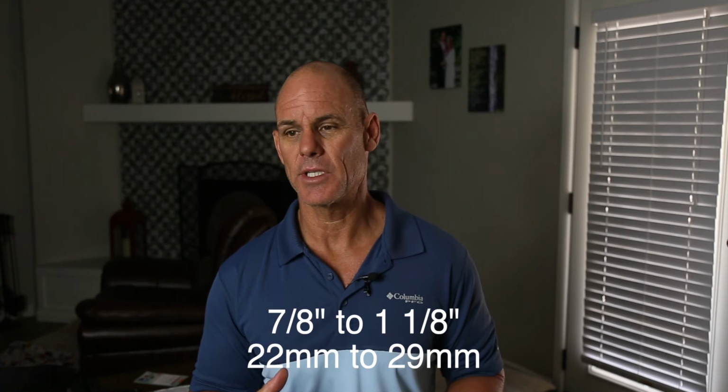And I think the main reason for that is, number one, the front has more weight on it with the motor and then the extra 48 pounds from the skid plate and bar. Plus, as someone mentioned in the comments, I think part of it is the fact that these springs are actually made so that your car doesn't sag when you load it up. So for towing and when I'm carrying stuff, obviously that's gonna bring the back down probably more in line with the front. So it's nothing I'm really worried about at this point.